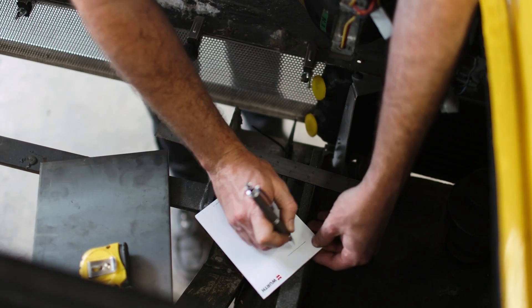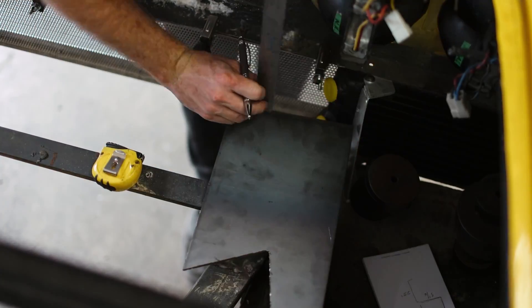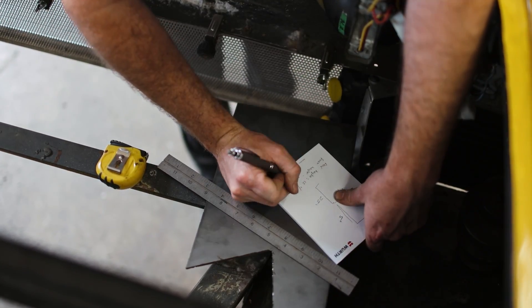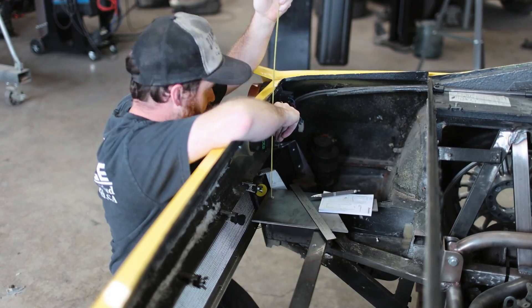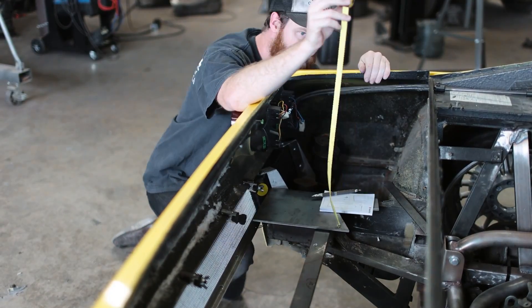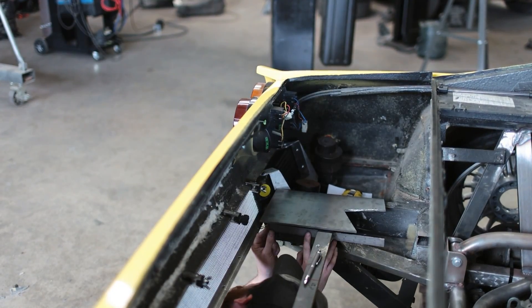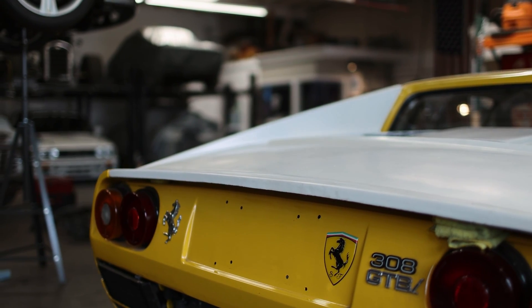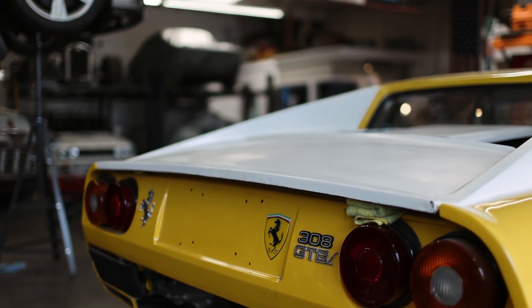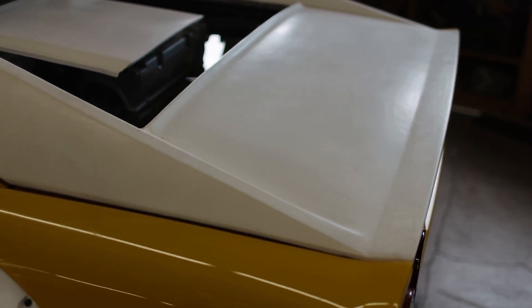It's also helpful because I really don't want spoiler uprights protruding out of the back of the car, which is what comes to mind when most people mention a chassis-mounted wing. This should be a lot more elegant overall. For this project we need to design a lot of parts — mounts that will attach to the chassis and the wing uprights themselves — and I want all of these parts to be water-jetted or laser-cut for a really nice finish. These rear wing uprights will have to pierce through the back hatch of the car, which means the wing element needs to be removable in order to get the hatch itself off. It's kind of tricky, but I'm sure we'll figure it out.